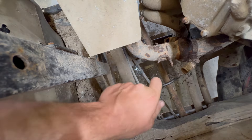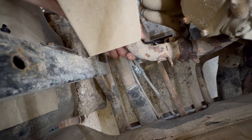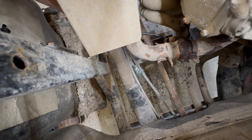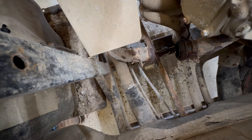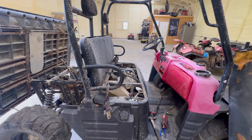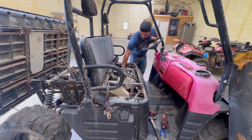Well, this has been an interesting turn of events. These Polaris 500 engines are tanks though — doesn't matter, these things always seem to just run. The X2 being frozen and I rode the hell out of that machine and after I got it running I couldn't find a single problem with it. He said a hurricane hit that year too, so I wonder if this thing got submerged. Let's turn that pipe a little bit sideways and let it drain. Pipe's warm. Yeah, the pipe's full of water. Let's try starting it again — check the oil first. Looks bad but not wet with water.